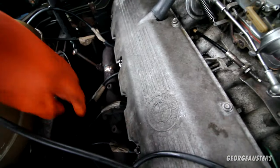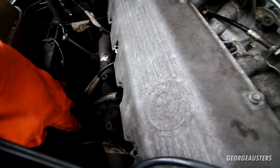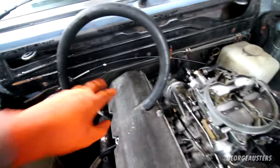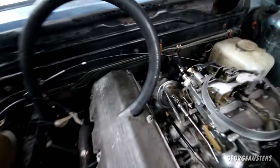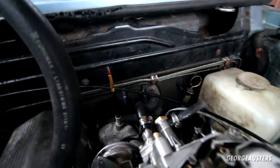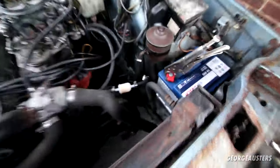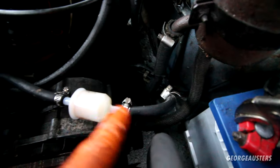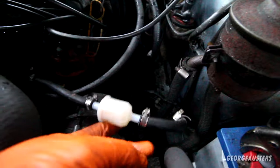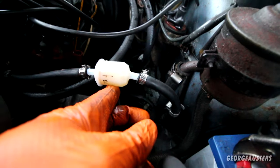One thing I've noticed: the HT leads are making contact with the exhaust manifold, so they're just going to melt. I definitely need to put the heat shield back on. This makeshift crankcase breather was blowing out the side all over the carb, so I've rerouted it to the ground. I've ordered the genuine BMW pipe that goes from there to there — a paintbrush is currently blocking the port on the intake manifold until it arrives. I've also installed a fuel filter on the inlet hose and it's coming through pretty clear — I think the fuel tank must be in good shape.